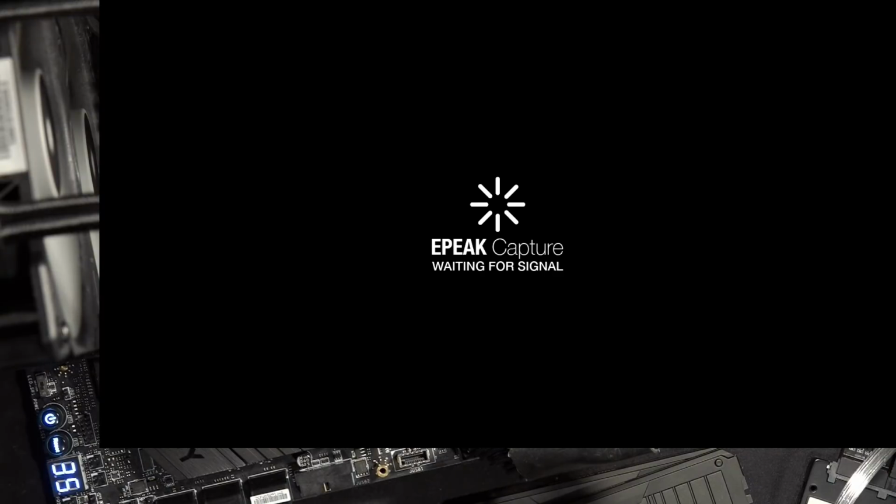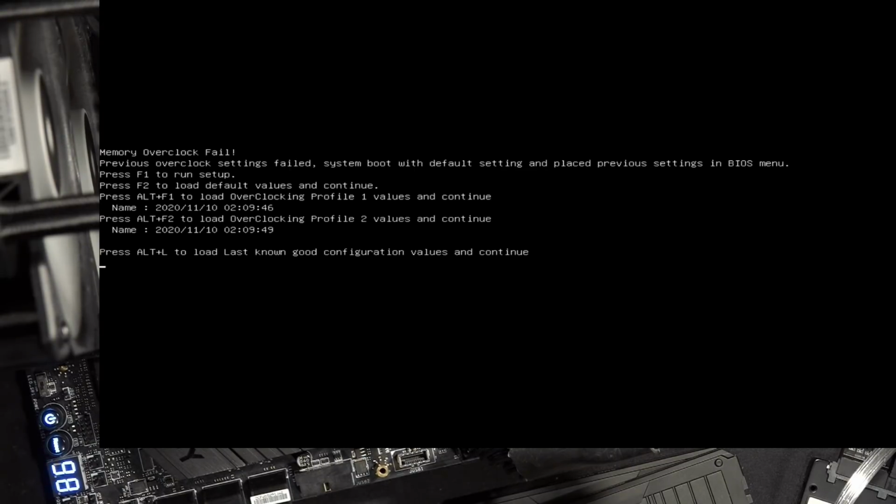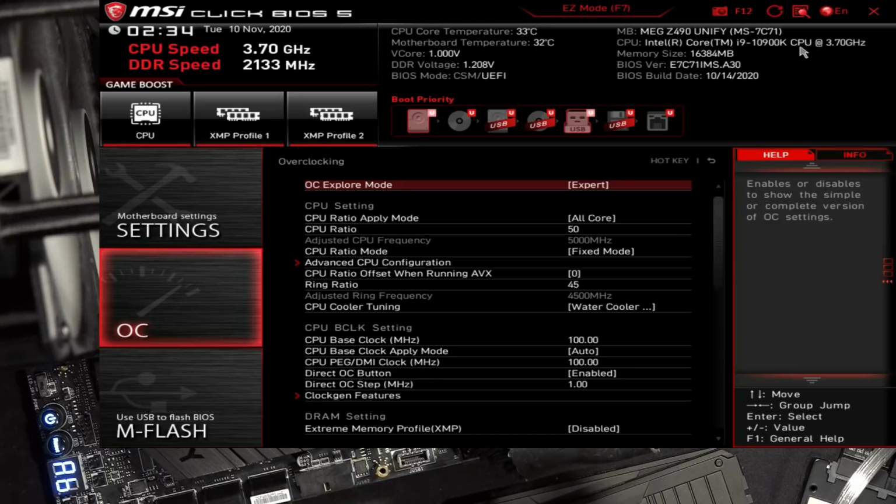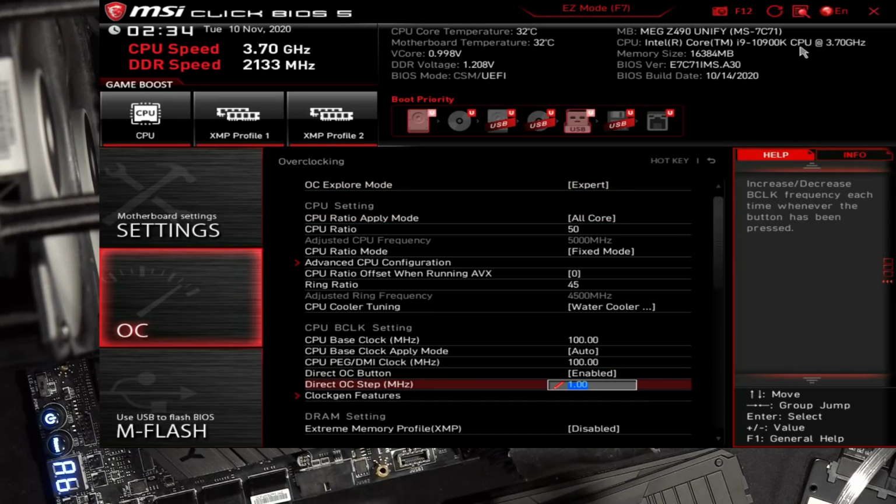I saw a 55 on the postcode, so I think the memory controller is already very upset about something. Yeah, I don't think this is going to work, considering it actually 55'd on the postcode. Ah, there we go. So 4800 doesn't even boot. So that's the single rank Samsung B-die setup done, right? We can go up to 4666 and it spits out 600 gigaflops, but 4800 doesn't even post.